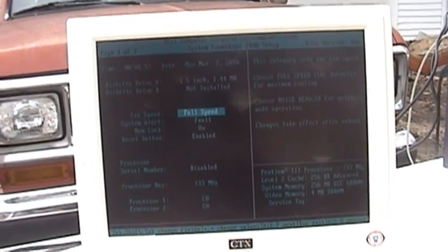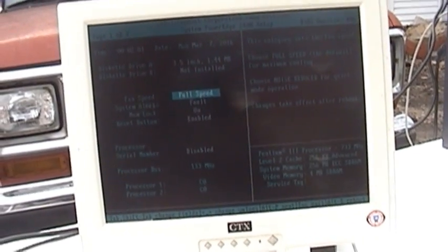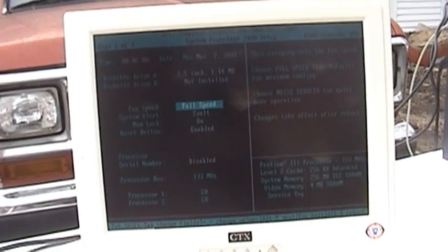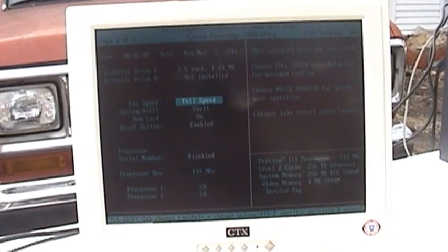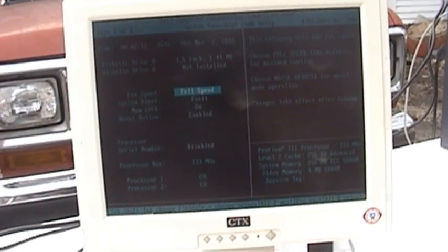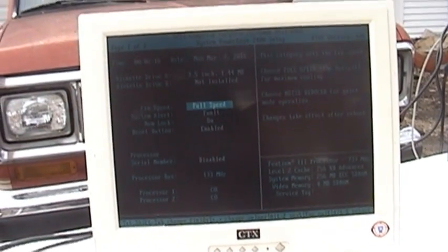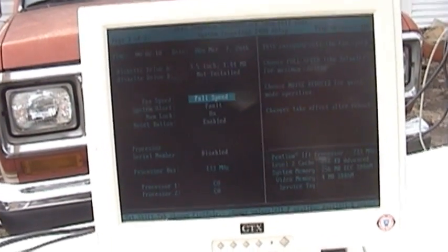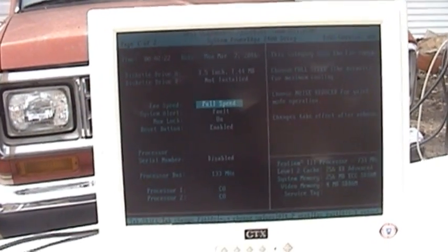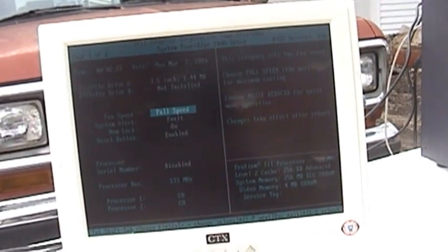Only later did I discover, when the receptionist and the bookkeeper finally complained about it enough and asked if there was anything I could do at all, did I go ahead and install a copy of SpeedFan and discover that even though they never utilized it, Gateway, or whoever designed it for Gateway in all probability, actually wired that system for full fan speed control. And so it was quite possible, once it had booted into Windows 2000 Server, for the system to run almost silently, and it never had a problem. It didn't overheat or anything like that.